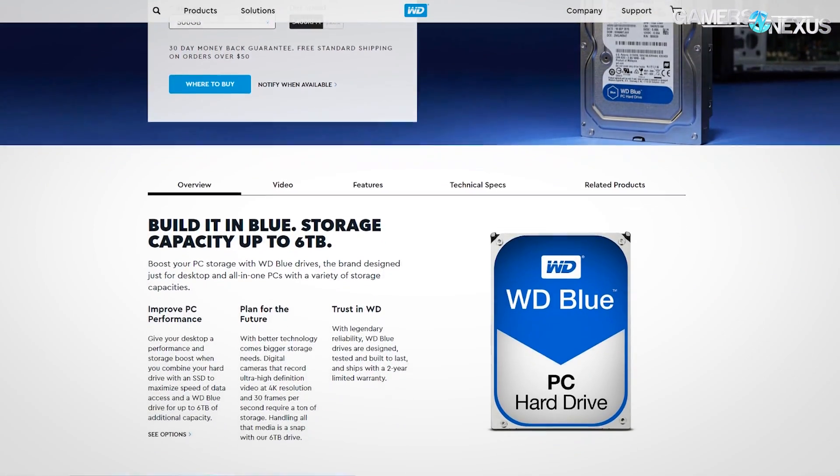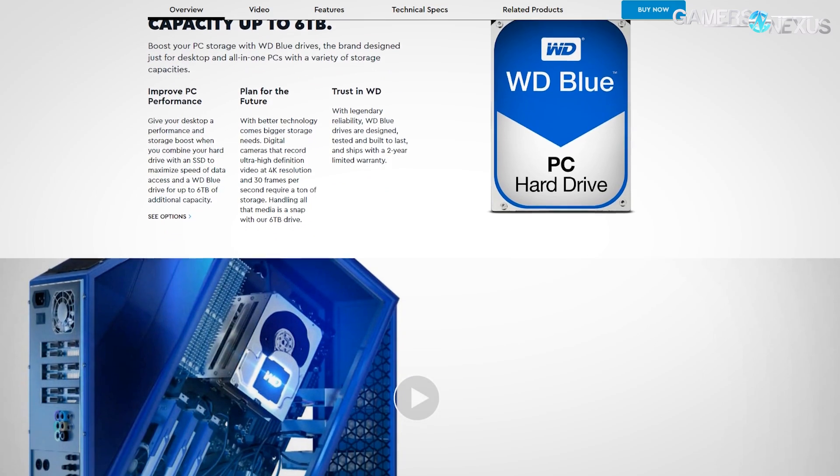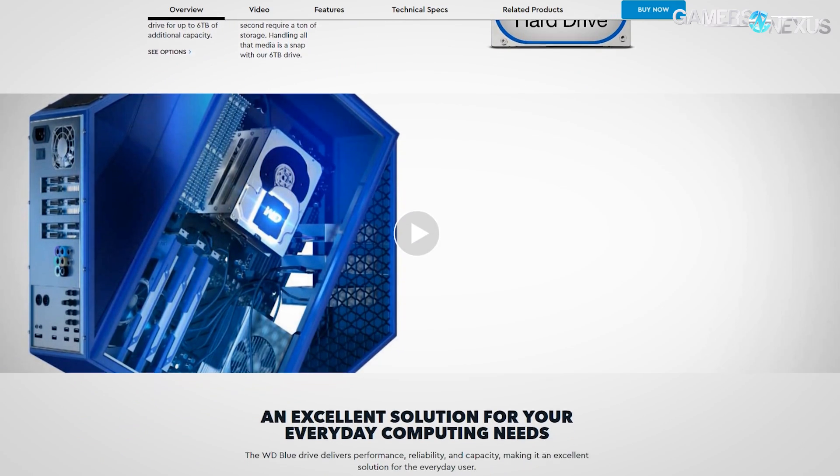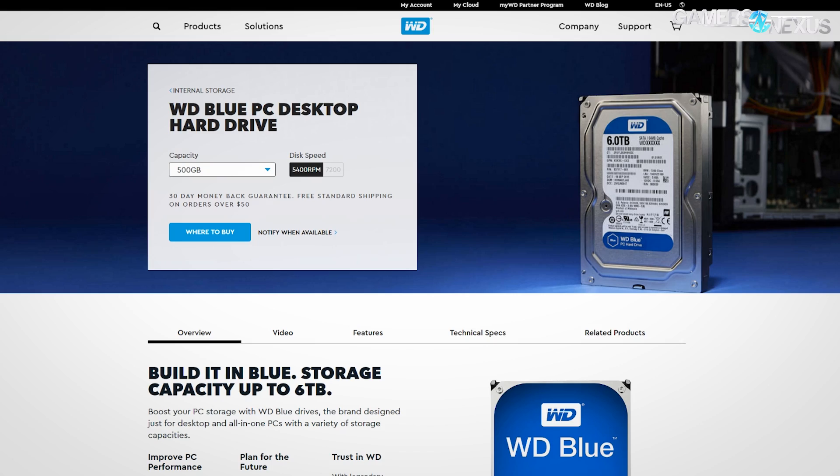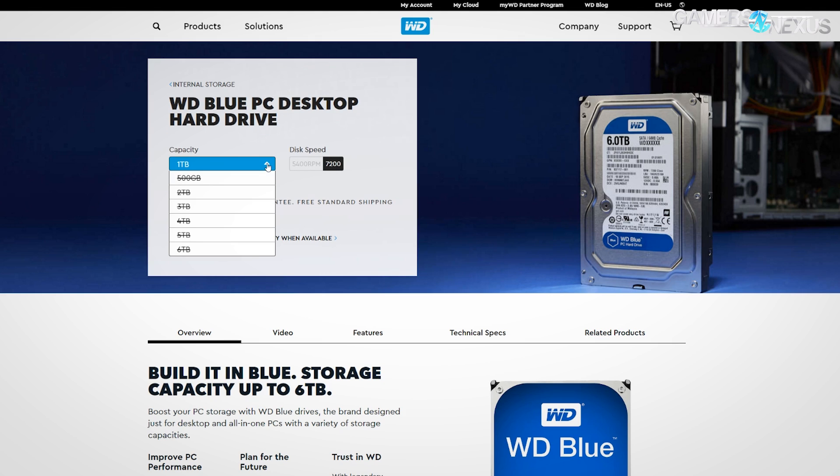There was a brief period where WD Reds were a better buy than WD Blues because they were the same RPM, same capacity, and in some cases were cheaper. That's not really something that exists anymore, but it shows that if you do some digging and don't need exactly the feature set of a particular drive, you could get away with using another one. WD Blue is the most common Western Digital drive we recommend for gaming storage alongside Seagate's alternatives, but we do so carefully with WD Blues these days. The previous WD Green line has been consumed by WD Blue, and Western Digital now offers both 5400 RPM and 7200 RPM WD Blue drives at 1TB and up.